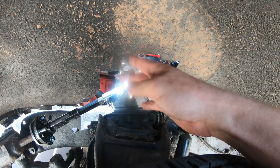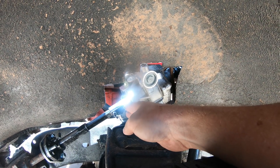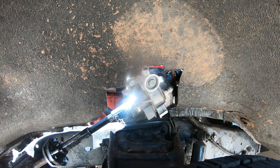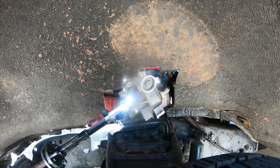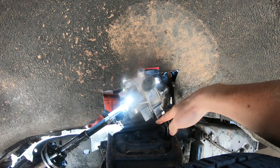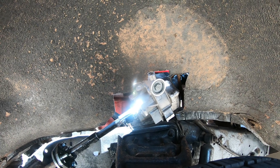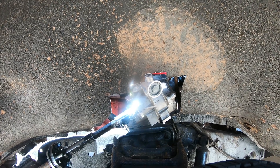As you can see, I had to cut out part of the fender well. I did have the motor mounted about three inches this way, so that's why I have all these notches cut out here — cutting a little bit at a time so I wasn't just cutting out a huge chunk. These are the original ones and they're not in the greatest shape, but this is driver quality. Like I've always said, we're not going to SEMA with this thing. Maybe in the future I'll find a way to make some kind of sheet metal piece to keep water out, but it's Phoenix — it rains very, very little — so I'm not really too worried about it.